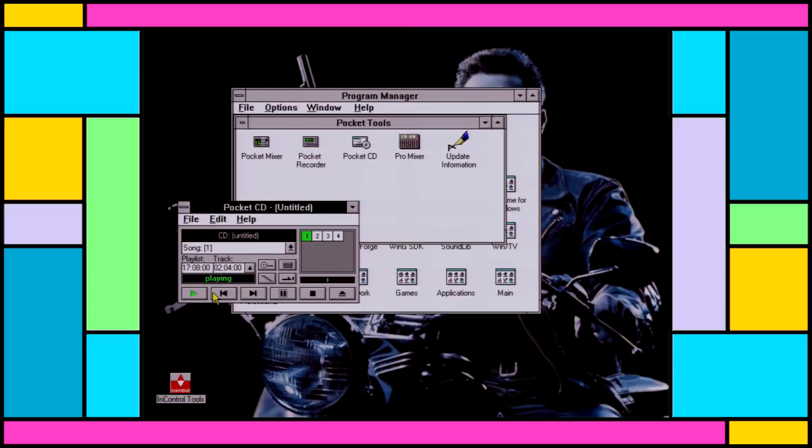The differences in the audio also quickly present themselves under Windows, because Creative uses the more common patch set for the FM synthesizer that seems to just be the stock thing that always comes with Windows, where MediaVision use the Voyetra patches by default. Although the driver gives you the option to change them if you can find more, which isn't something I have around. Then again, you could supposedly tamper with the Soundblaster 16 to use Voyetra patches with that card too, but we're leaving as many things on default as possible here to keep a level playing field.